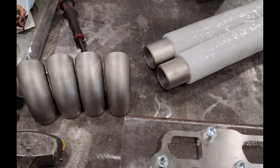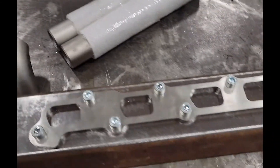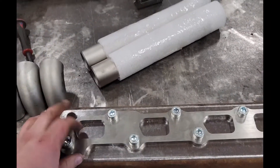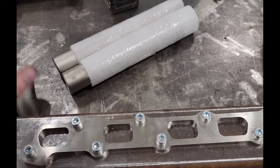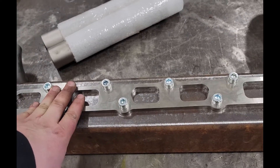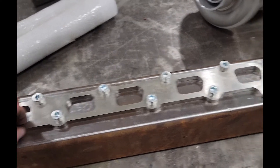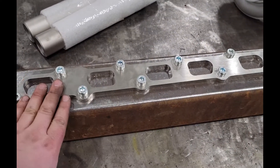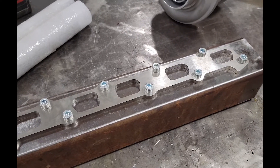These will be the turnouts to go to the T4 flange. I was originally gonna go all mild steel, but a lot of the stuff was out of stock — they'd have long radius or they'd have short radius but not long radius. So I ended up going all stainless. The only thing I forgot to get is a wastegate flange, but we'll do that later. I just have to think about it while I'm building. I'm gonna start tacking some elbows on and get some measurements.